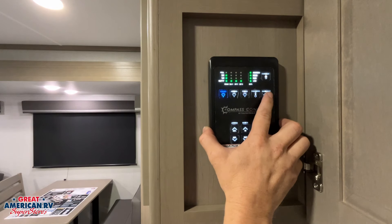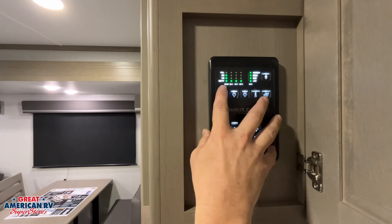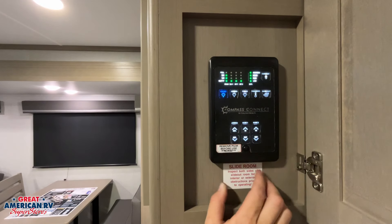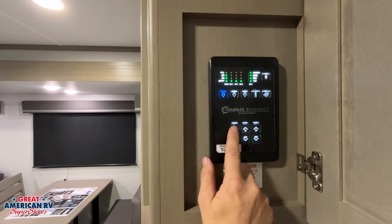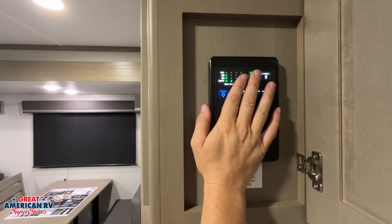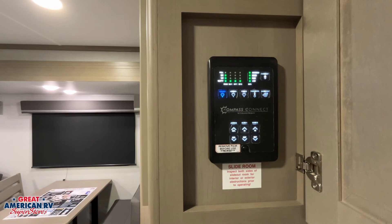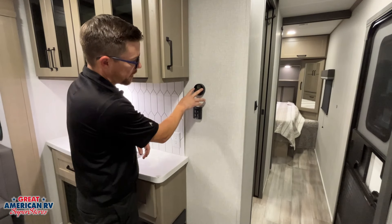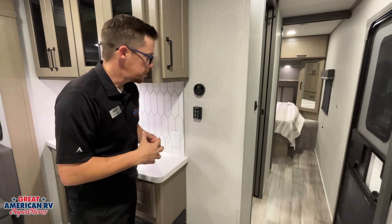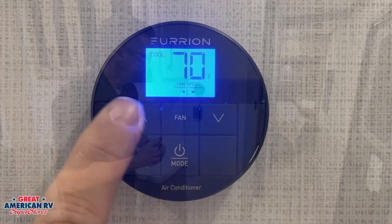If we have a city water connection, make sure that pump is off. This is an on-demand pump — it'll only come on when we're actually using water. If you suddenly hear that pump running and you're certain we're not using water, shut that system off, because maybe our fresh tank is empty or we have a leak. We don't want to burn that pump up. Down below we have our awning and slide out controls — all 12-volt operated — and you'd find most of it in our 12-volt fuse panel near our breaker panel.